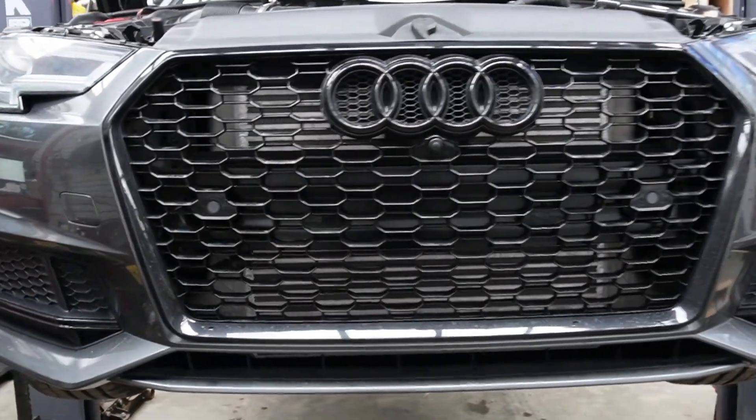There it is — Kyle has finished the install of this massive intercooler from Integrated Engineering, peeking through the honeycomb grille with much more surface area than the OEM unit. Now that the install is done, we have to put it to the test. I'll go out to the exact same road, report the temperature and density altitude, do two more back-to-back runs, and share the logs to see how much we've improved those intake air temps. We're back out on the same stretch of road — the ambient temperature is now up to 52 degrees Fahrenheit and density altitude has raised to negative 230, so conditions are slightly worse for the upgraded intercooler.